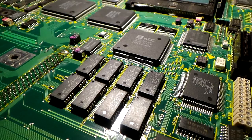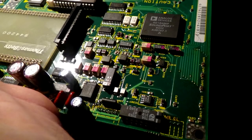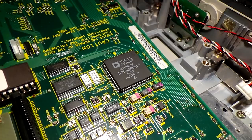It does have a genuine Yamaha OPL3 chip, but it is unfortunately connected to a Microsoft Windows Sound System, which isn't all that useful for MS-DOS games and applications. I can't get the Sound Blaster compatibility TSR to work no matter how hard I try — it says it's worked, but it doesn't work. It seems to be an issue with DMA. It's kind of obvious to me now why this never really caught on.